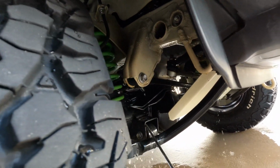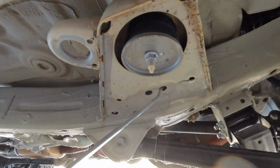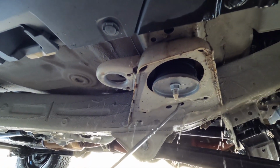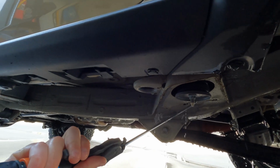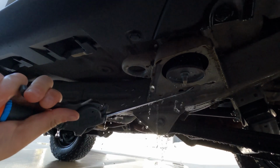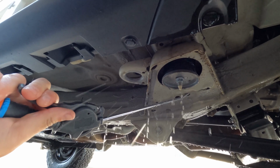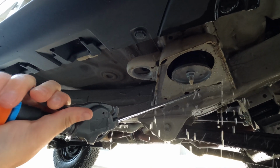The chassis has a range of holes underneath, which can be really annoying to get to. And this is where it becomes a bit of that tedious, annoying thing to do, because you can see here, you've got heaps of holes, right? Put this in, you just see how all of that sand would come out. Obviously it's not that much right now because I did this 2 weeks ago. But this is often where it will just sort of store itself and corrode your chassis from the inside, and it's just not something you want.